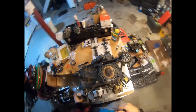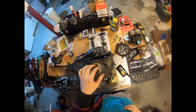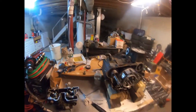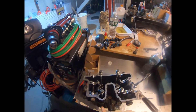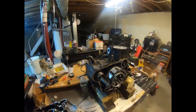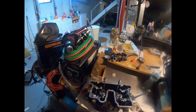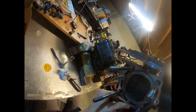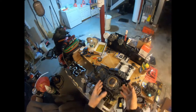We got the head off - the piston looks actually really good, like this honestly looks like a perfect piston. So before I get into it - the piston looks good, I'll check the rings when I get to it. One of the other things I realized when I was taking this part off camera was that the intake valves were leaking air on the compression stroke. So there was an intake leak on the valves - I don't know if they were just dirty or I'm not sure yet. We're going to investigate this more, probably next episode.